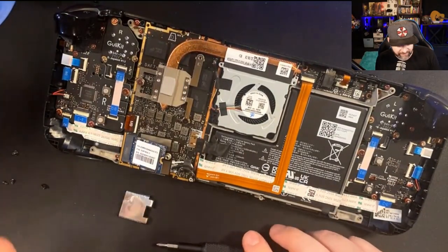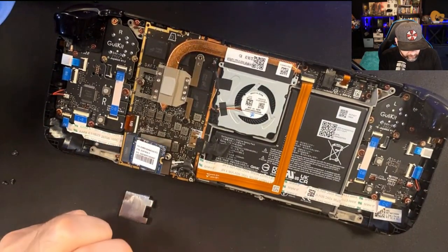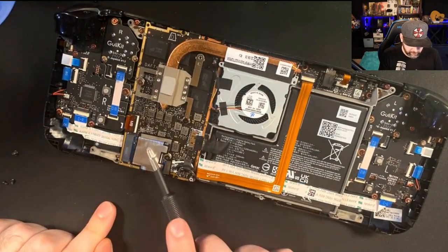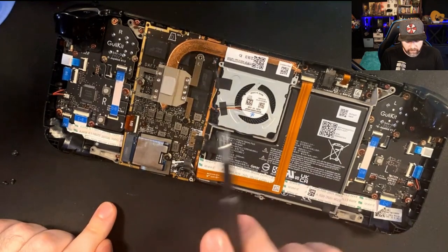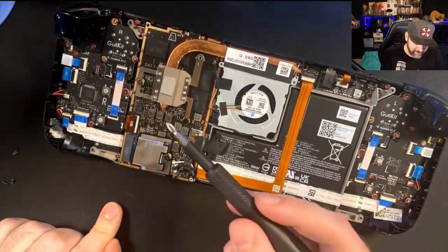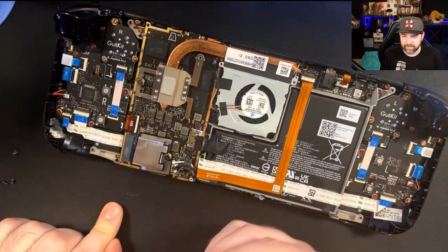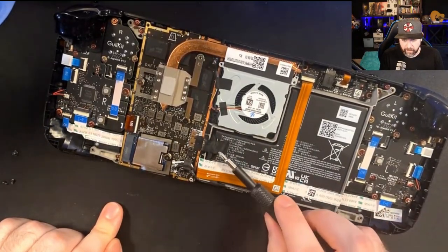That's really it. Once you've done all that and got your new drive in, make sure the heat shield's on there. Just a couple of other notes before shutting it back up: avoid touching these different points together with something metal, as I've run into issues where you can potentially short something — and it's not even a static short. That's especially true if power is connected, which is another reason to remove the battery power.